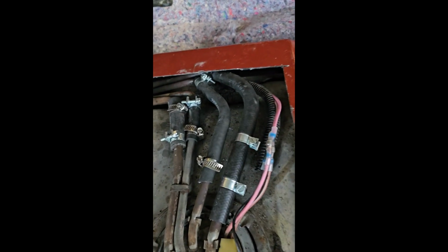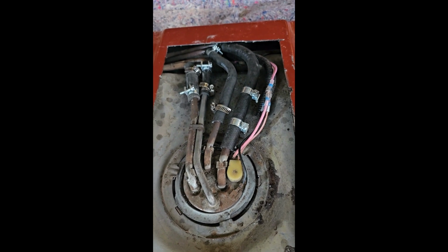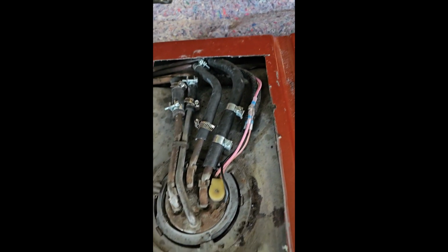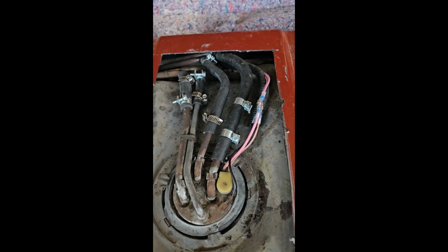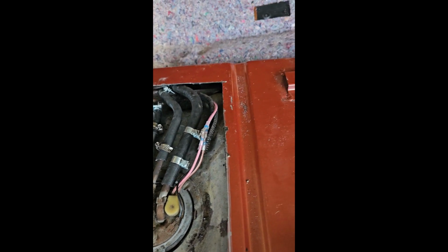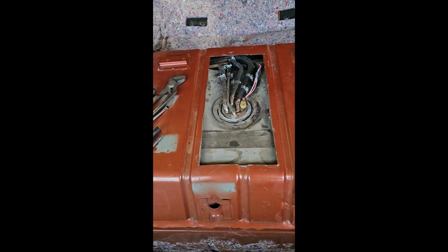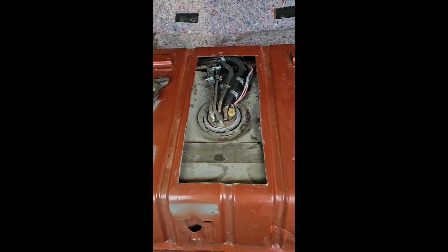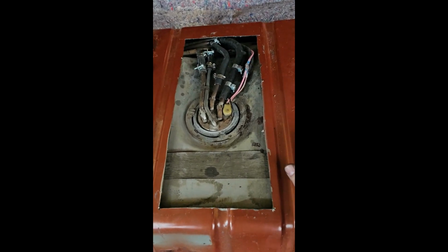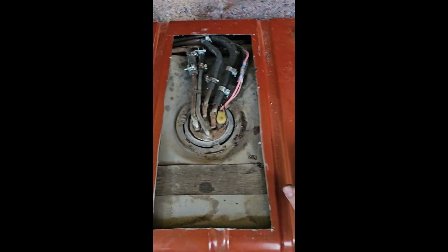Alright, so I got a little bit of a mess here, but I'm going to clean it up a little bit once we verify the fuel pump's working. I'm going to go ahead and check under the car, the new fuel filter, make sure it's not leaking there. But I'm not seeing any drips so far, so I think we're good. In the next video, I'm going to make a nice cover for this. So now we got everything rigged up. Let's see if this thing will fire and idle.